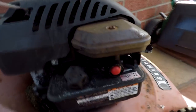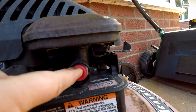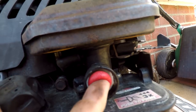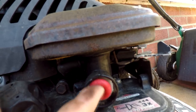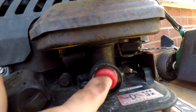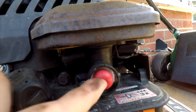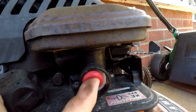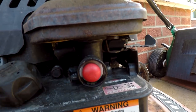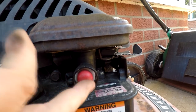This lawnmower here is my own personal lawnmower, and the reason I wanted to show you this is because I did fit last year a pattern primer bowl. I went to prime it the other day and it's actually all cracking and splitting - this has only been on since last summer, and it's going to need replacing again very shortly. The point I'm showing you this for is that pattern parts, although they seem good when they're new and look identical to original ones, the deterioration factor is very prevalent. If you're servicing people's lawnmowers and putting these pattern parts on, beware - they're going to come back to you and they won't be very happy after one season. I only get the original stuff when it comes to these sort of things - they're rubber, you're pushing on them all the time, and pattern parts don't seem to cut the mustard.